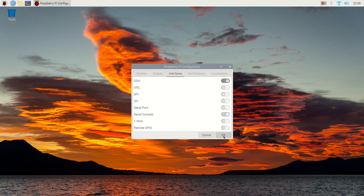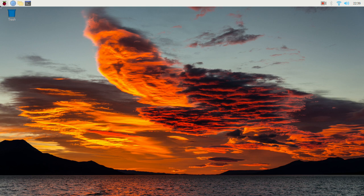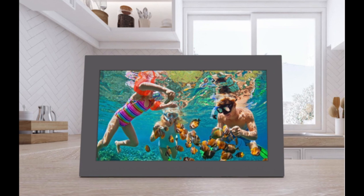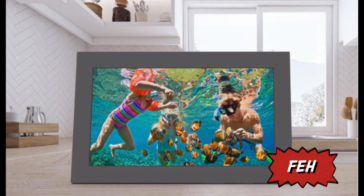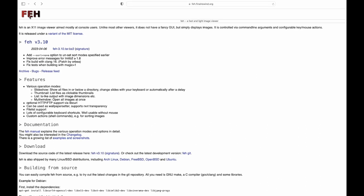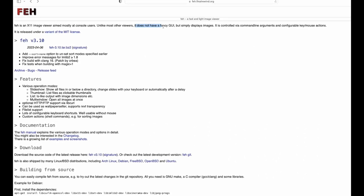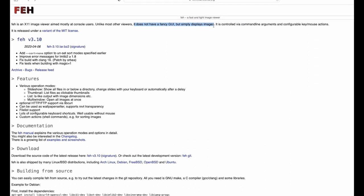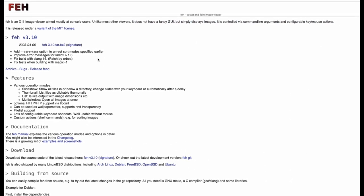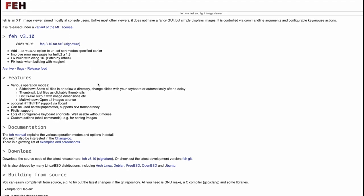There is no easy way to exit the slideshow unless you turn the device on or off. To set up our slideshow, we are going to use the FEH package. FEH is an image viewer and cataloger — a fast image viewer that doesn't get bogged down with huge graphical user interface dependencies. I chose this as it was one of the most lightweight packages that worked without any complications.